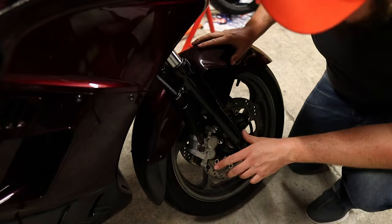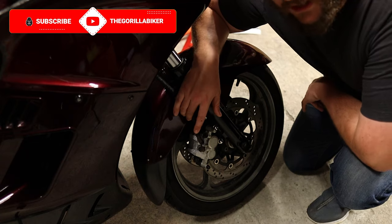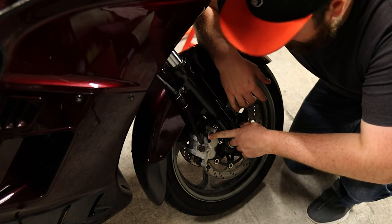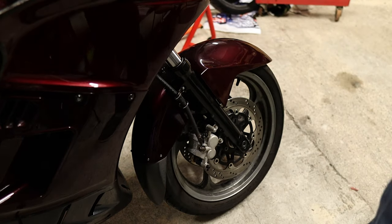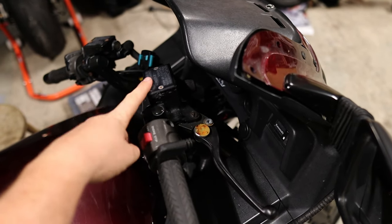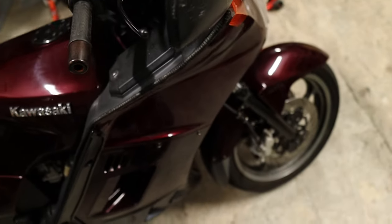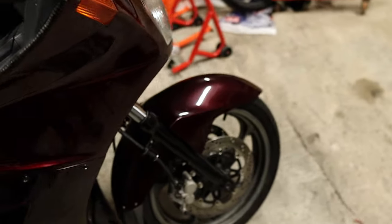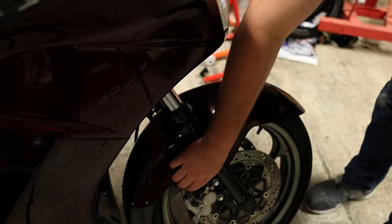First and foremost what I'm going to do is just bleed as much fluid out of these lines as I can and then disconnect them. The bleed nipple is right here — we're going to bleed out a bit of fluid through here. We're also going to mop up as much fluid as we can from up in the reservoir, so I'm going to open up this reservoir and mop up the fluid with some blue paper towels.